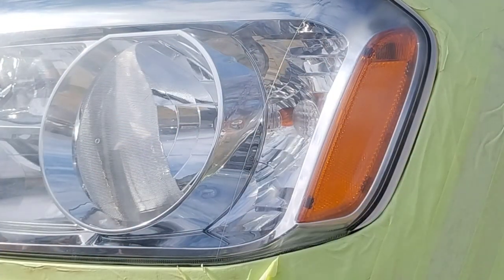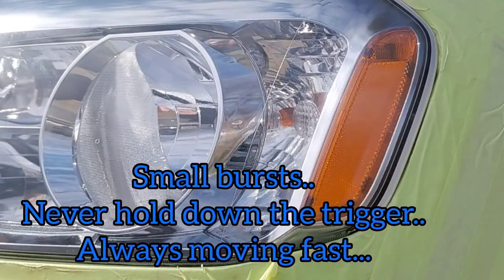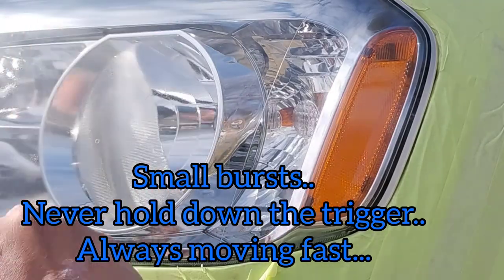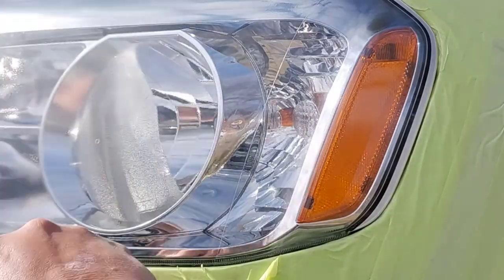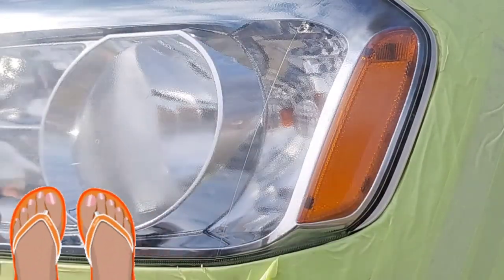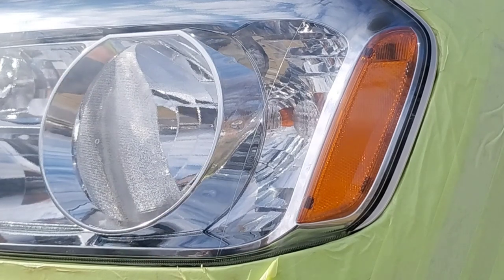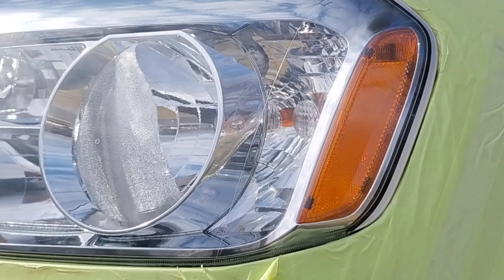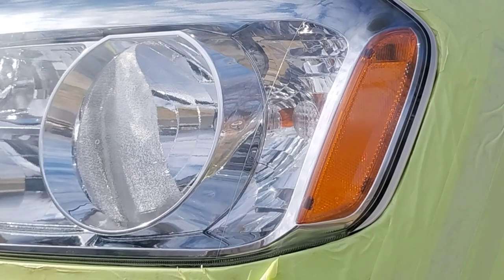I don't say, look at this headlight, look how ugly it is in orange, I just polish it and there you go, it's clear. Yeah, it might look clear, but that doesn't do anything. It's going to come back right away. And as a matter of fact, it's going to come back worse because now you have this polish residue, which most people use the wrong stuff, like metal polish and foot polish, just weird stuff. And then it sits there on that headlight and it dehydrates and dries, and the residue is baked onto and into the headlight. So now you have a worse problem where somebody has to charge you more to remove all this stuff to give you a proper headlight restoration.